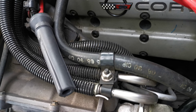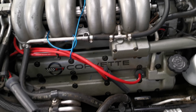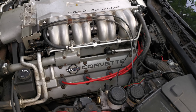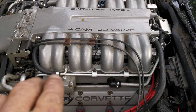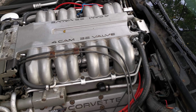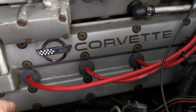That air conditioning and heater housing over there is what makes it tough, but that's the worst one on it. I'm going to go ahead and change them all out. I'm hoping this fixes it because that number six back there — I knew it was misfiring — and it was just a two-dollar plug. I've had this plenum off three or four times checking stuff. It's a beast, but once you do it a few times it's like butter.